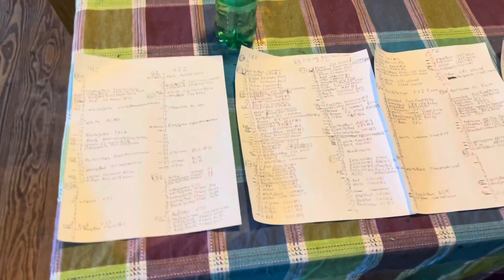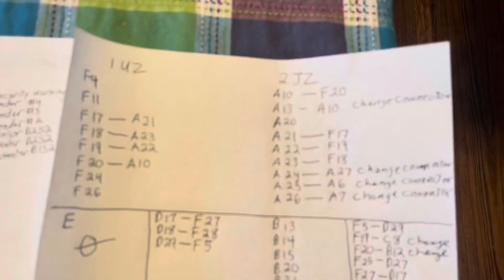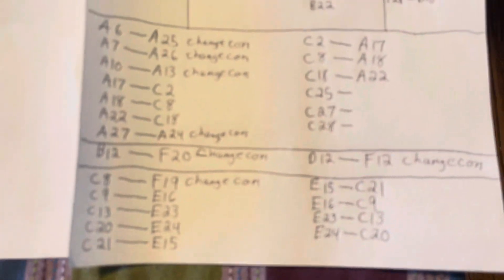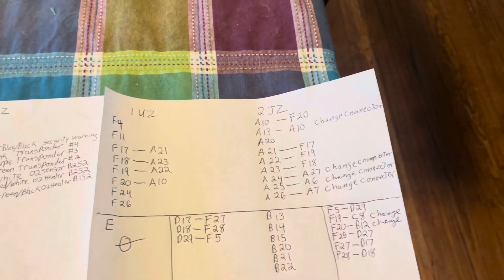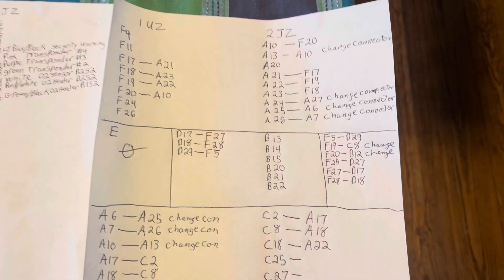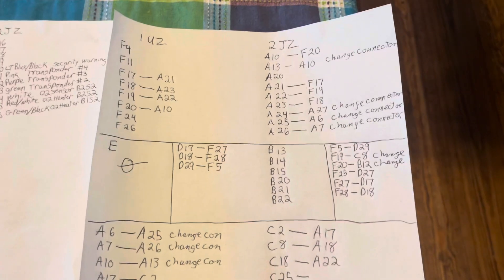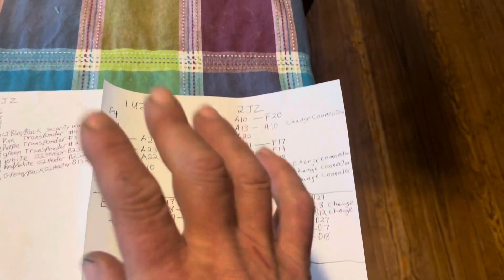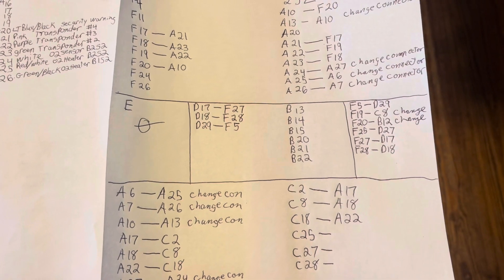Alright guys, it's the next morning. I'm back at it. I've got all my ECU pinouts done. What I did was I made a little cheat sheet for what connectors need to be changed to what location. This is probably going to look like Greek to you guys because you don't know my key for all this, but I'm going to simplify it — I'm actually going to label what connector is what so it'll be easier for people to do this in the future. This is just for the ECM. I do not have any of the stuff for the body control module, for the ABS traction control, any of that stuff. This is strictly for the ECU so that I can get that wiring done. Then I'll focus on doing the ABS and traction control, the theft deterrent, and all that kind of stuff.